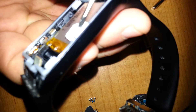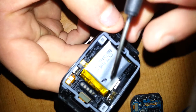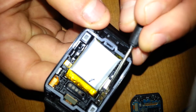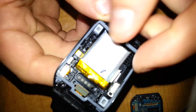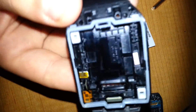Once you have done that, most of you are going to want to pull on the little pull tab — and that's not the case. There are two battery leads that connect to the motherboard, and you're going to want to remove those gently by lifting from the back left corner up. Then you can pull the battery right out, and you're left with the watch housing.